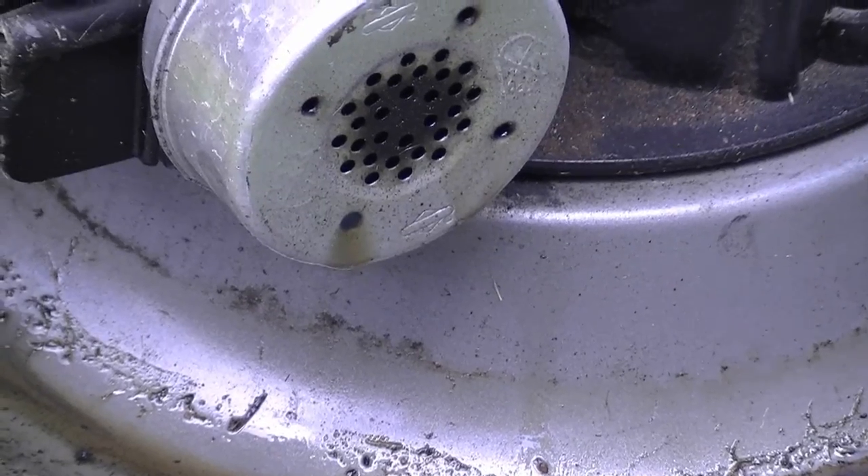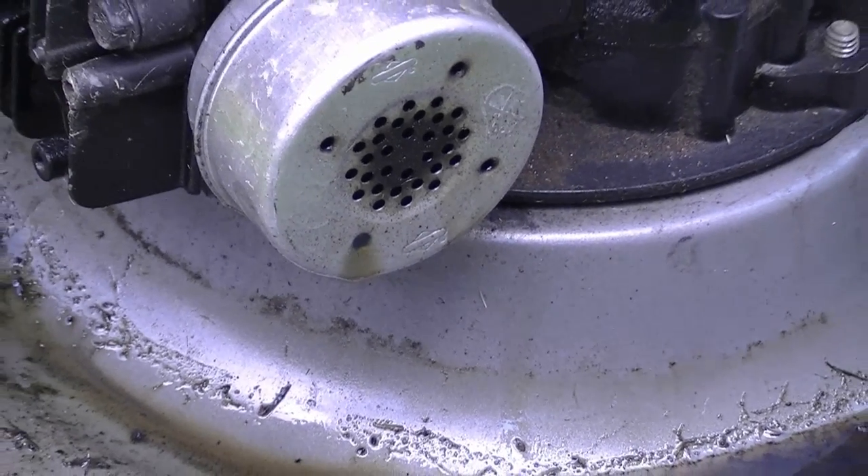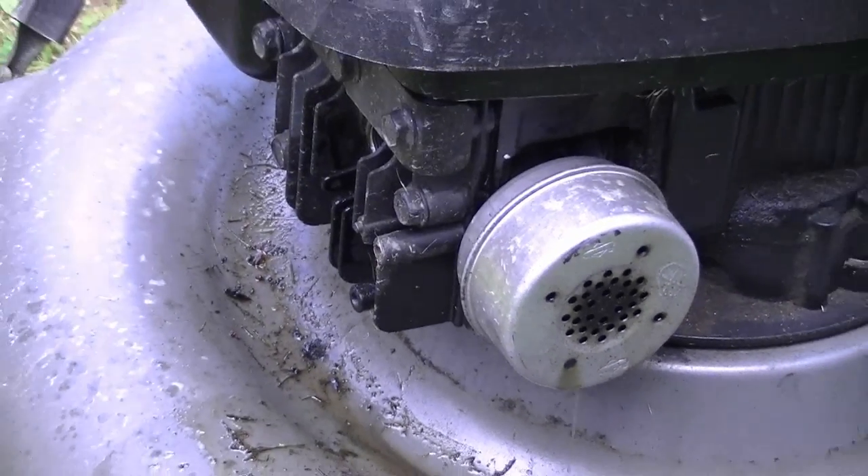As you can see, there's more oil coming out of the muffler — that's a good sign, it means it's draining itself. Just repeat that process until you think you've removed all the oil from the engine.